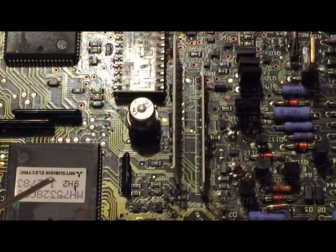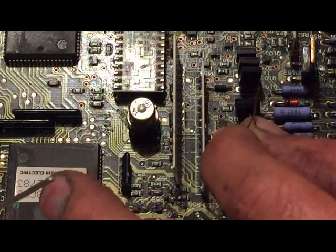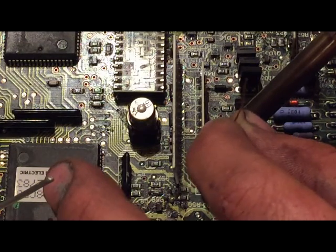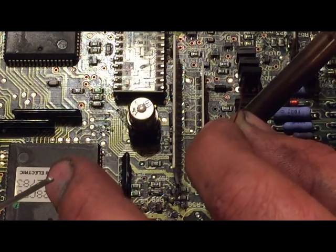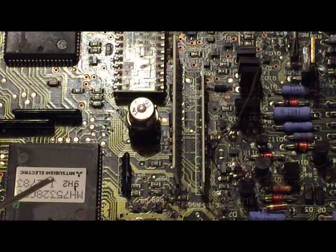Other ones that you may not be satisfied with, you might want to put the jumper wire on there. Be careful when you're scratching the surface of these contacts with the solder iron next to it. If whatever you're scratching it with makes contact with it and seats and solders down, and then the soldering iron comes away from it, it may pull the lead off the board. You don't want that.